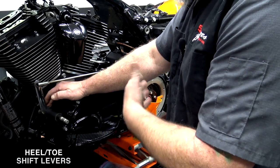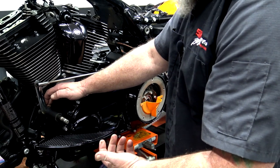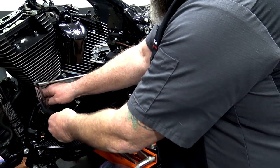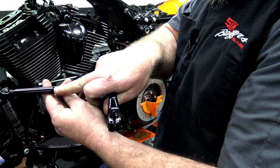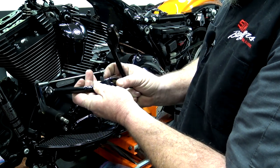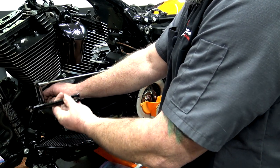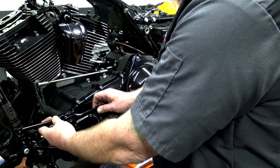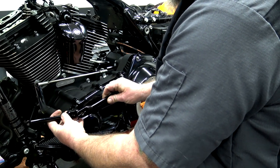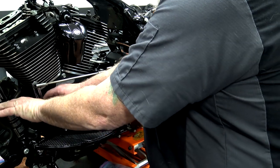On to your shift lever — this part is pretty easy, pretty self-explanatory. You're going to have a rubber bushing that goes on here. When you pulled your shift levers off to powder coat, just leave that on there. This runs inside some bushings that are in here. On the backside of your shift levers, you'll see a mark — you want to make sure that those marks are turned towards the motorcycle. This is one of those things you might want to take a picture of before you take these off, so you know where you had your shifters. You can put them at a couple of different angles — just make sure that when you engage, you're not hitting your floorboard.